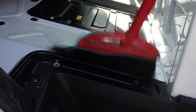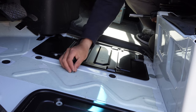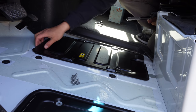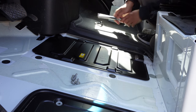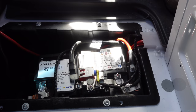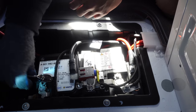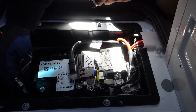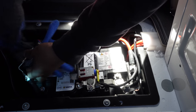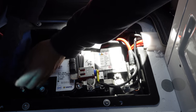We're taking off the battery first because there are some electrical components under the seat that we don't want to accidentally get electrocuted by. So we're going to take the battery off and just disconnect. I'm going to put these in the cupholder so I don't lose them. Here's the battery — we need to disconnect it. I'm doing negative first. Just loosen that up and it should just pop right out. There we go. Make sure this doesn't touch anything — you don't want this touching the positive side. I'm just going to put that in my glove right there. Make sure it doesn't touch that again while I'm working or else it'll be activated.